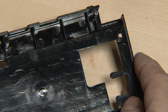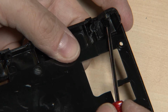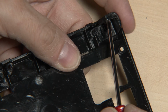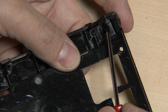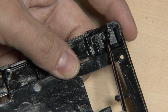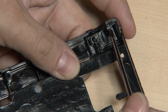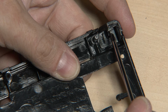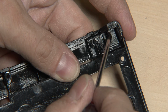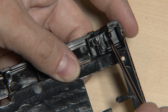And then the next step is fitting the shoulder buttons, which should also be easy, because once you put in that shoulder button, you need to be sure that this area where it pushes on the button is slightly below the PCB so that it does not hit the PCB, and it should hit the button. But as the PCB can't move up and down anymore, the position is very exact and you can fit this. Once this has happened, we can start to tweak the shoulder buttons, for example, make this a little bit longer or shorter, or make them move a bit more up and down so that they feel better.